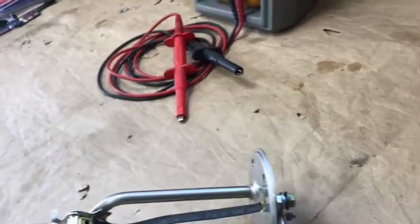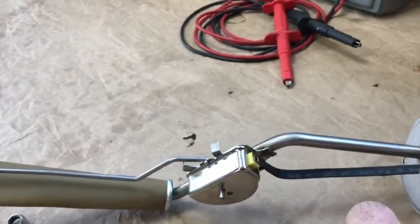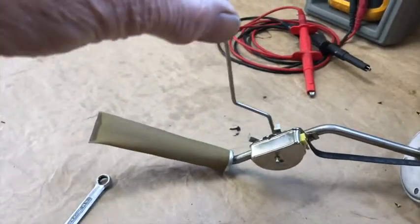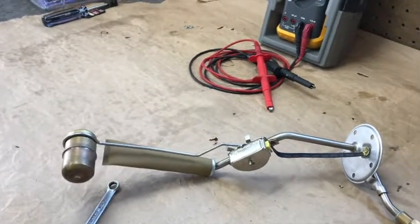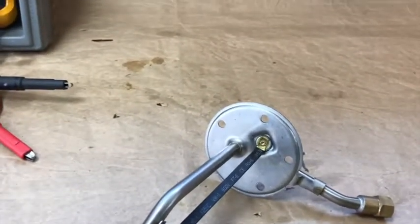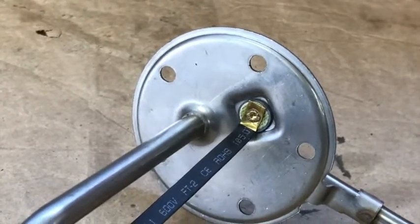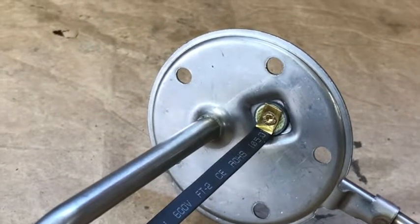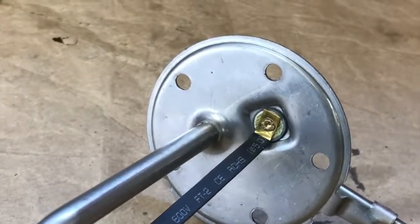Now it only came with one nut, first of all — I think that was an error too. And then there's this little brass strap that goes from that stud to the rheostat that changes resistance values as the float goes up and down. You'll notice the inside of that stud where that strap fastens is made like a rivet. It's not attached with a nut or thread — it's like a rivet. And what I found was that the strap was loose on that rivet — it wasn't making a very good connection.